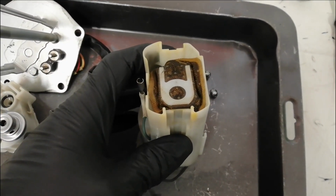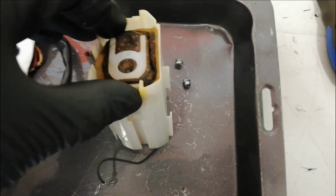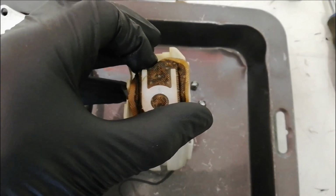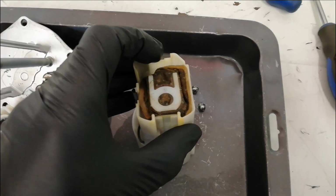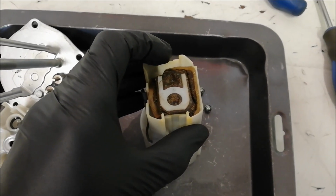The fuel filter is quite firmly fitted into the bottom of the fuel pump, so what you have to do is quite carefully lift it up a little bit. I try and then get a screwdriver in and very, very carefully flick the filter off the pump, just bearing in mind that if you actually put a hole through the tea baggy bit, then your filter won't filter anymore and you pretty much knacker the job up.